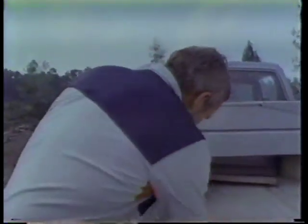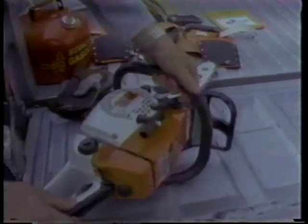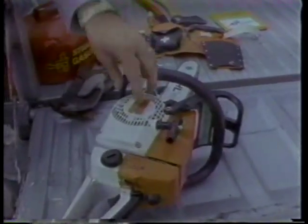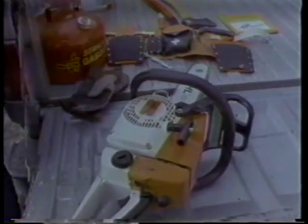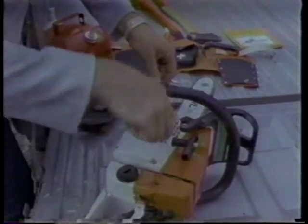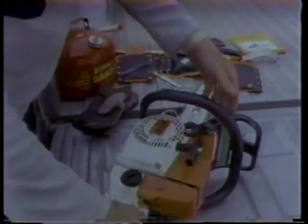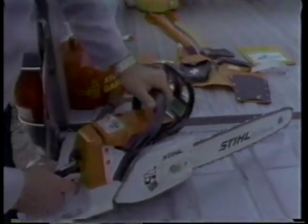When you're ready for that, think about the net you have up here also, so you don't forget to clean that. Put these things back again and lock it up. One other place is just the air intake — that means the air flow in there cools the cylinder. In some places a lot of dirt stops it, so clean that too.